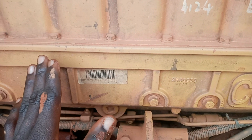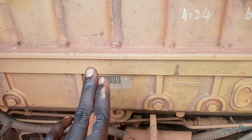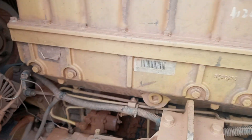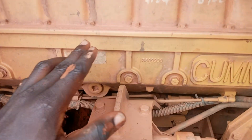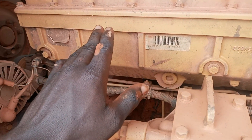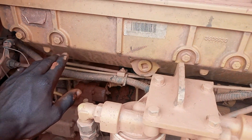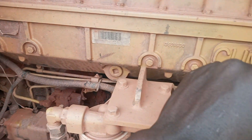Inside the head is where the diesel and the coolant meet. The coolant is cooling the injectors, which is also where the diesel is being supplied. That is the main factor we are considering. Our troubleshooting will start there — we are going to remove the injectors and pressurize the cooling system to rectify the leakage.